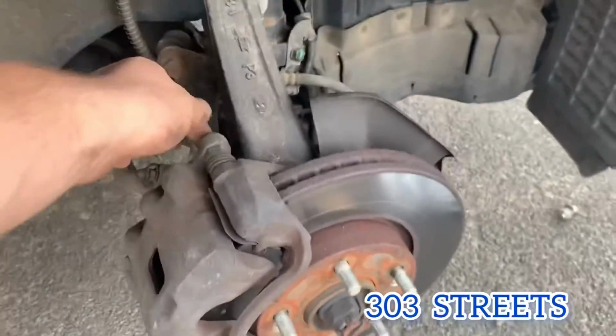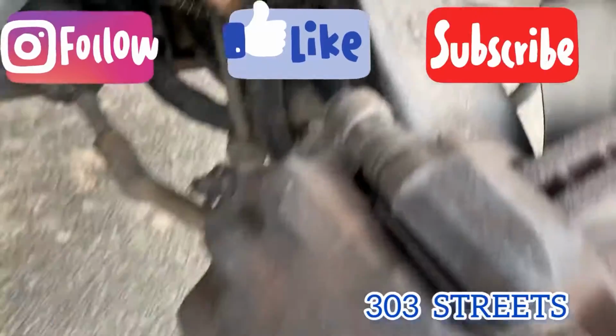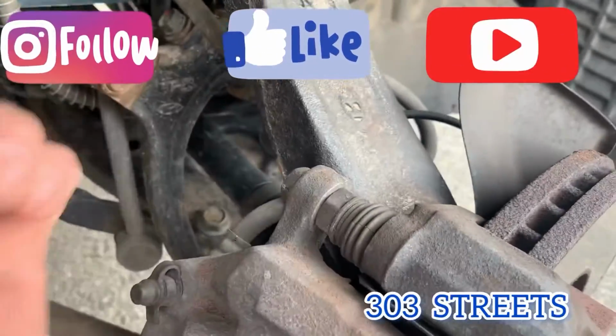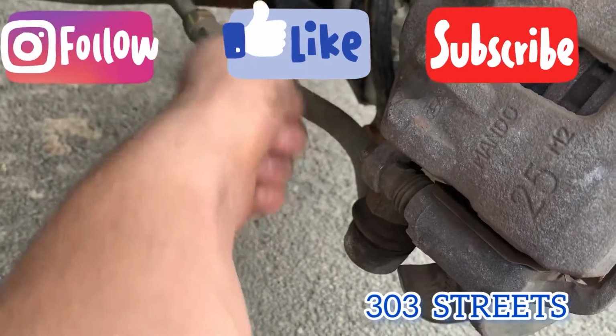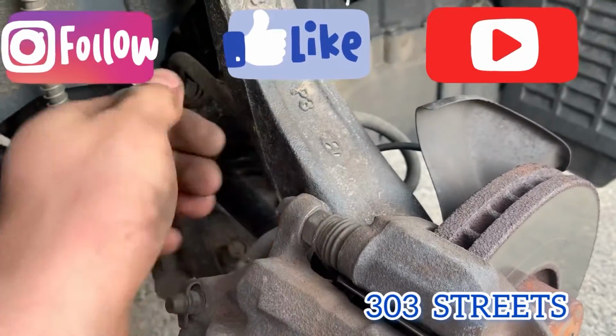So like I said, then you just bolt it back together where you took it apart. This is what it looks like. So if you're gonna take it apart, gonna use an adjustable wrench there, 14mm socket, break it like that, and then same thing down here, break it, and then you're gonna tighten it back down. When you're tightening it back down, hold this, and then tighten it back down.